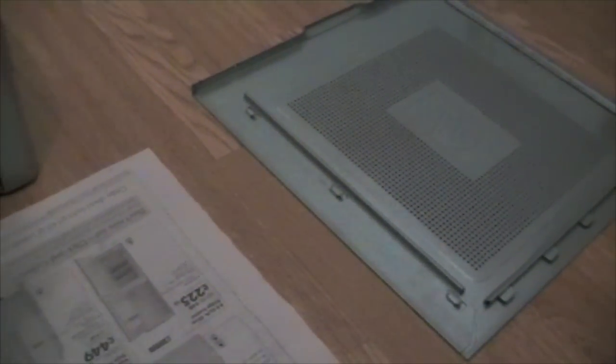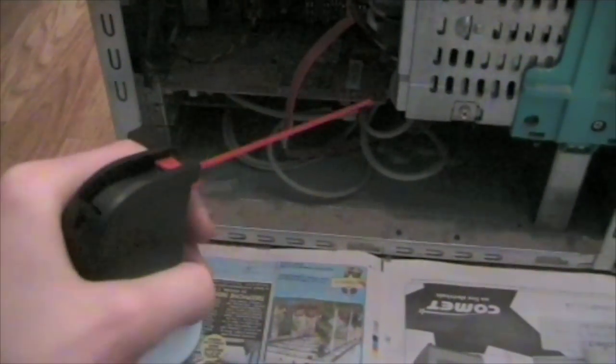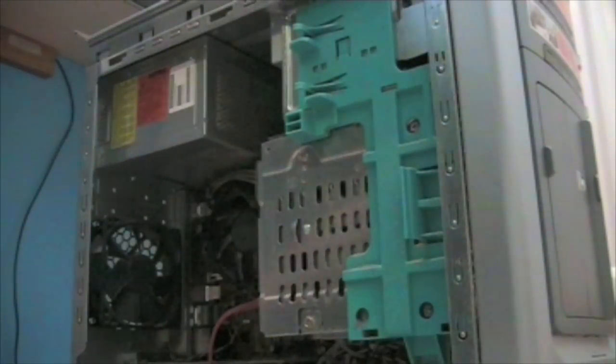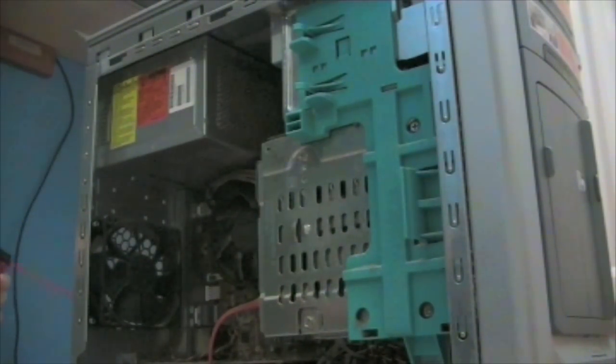If there's any kind of fan or component attached to the side of the case, you'll want to get some air sprayed into that too. When you're using compressed air, don't shake the can and keep it upright — you don't want to be turning it upside down to try and get into places at the bottom. Just keeping the can straight, I'm going to blow all the dust out of the vents at the back and all the ports. I believe this is called the heat sink — some kind of fan thing. Make sure you clean that well because lots of dust can get trapped behind the little blade bits. Don't spray from the back with your face in front, because you will get a face full of dust.